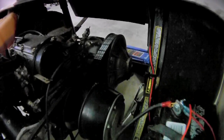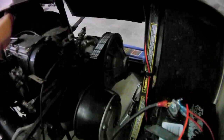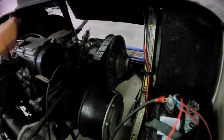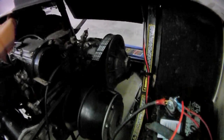I have the governor tightened down all the way right now. I'm going to back it off and put the speed back down to about 15, because right now it'll go about 20 and it's kind of scary. I'm going to show you how that governor works, because there are so many questions about it online and all the descriptions are hard to follow with no pictures, no video, no here's-how-you-do-it. Let's watch the clutches one more time so you can see what I mean by instant engage.